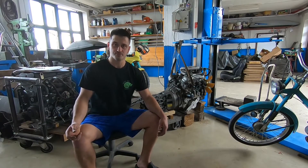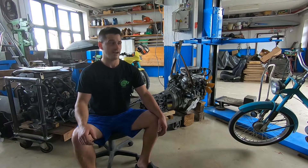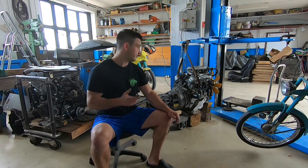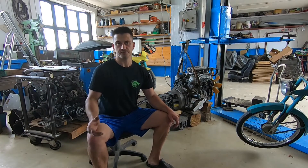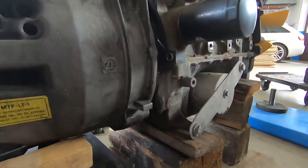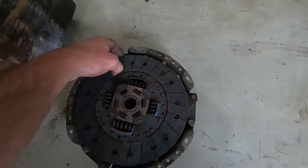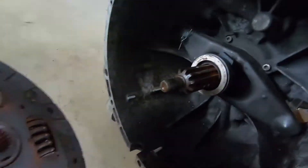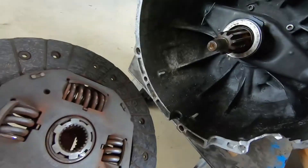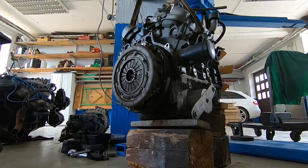Well, it seems to me that's not going to be so straightforward, as the Bayerische Motorenwerke has very little to do with Ford. The engines even sit at some weird angles in BMW cars. By the very looks of it, those two are totally different animals — the bolt patterns are way off. The gearbox input shaft is 34mm shorter on the ZF box compared to the Ford one. The spline shafts are different type and different size.